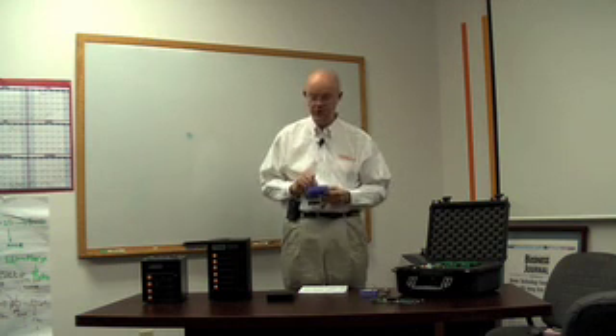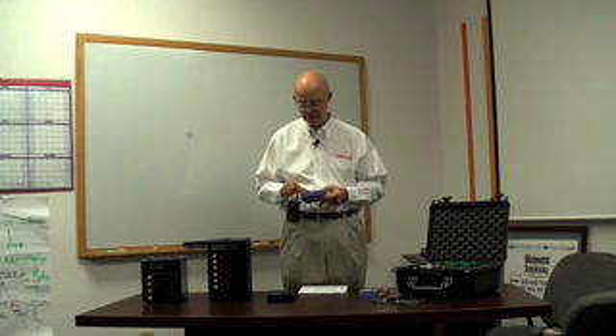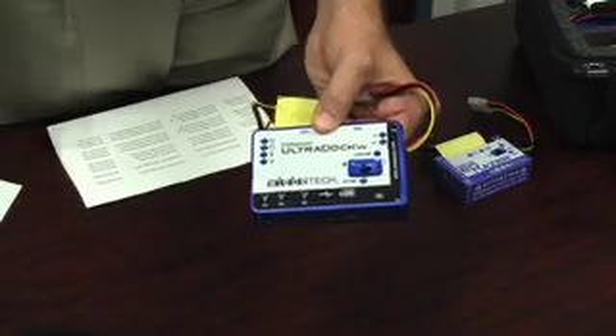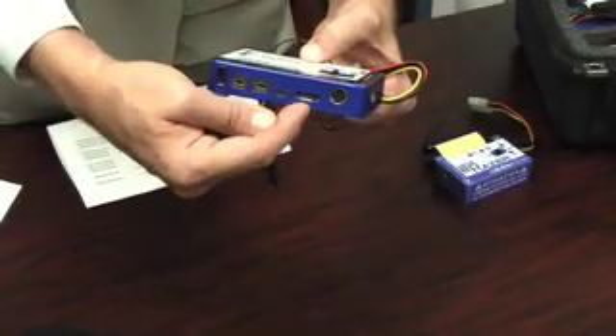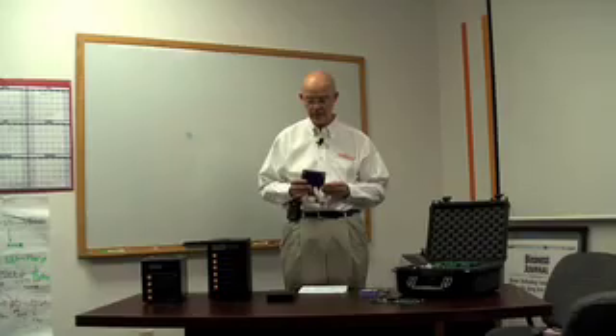In particular, you'll see that it has four different ways to attach it to a host computer. You can attach it via Firewire 400, Firewire 800 — which is daisy chained — USB, and here's a new one: you can attach it via eSATA. eSATA offers the very highest transfer rates possible, so you can get transfer rates up to 3 gigabits per second running via eSATA.